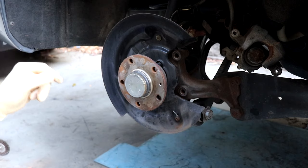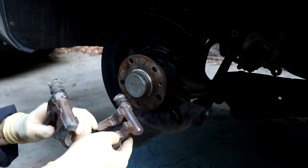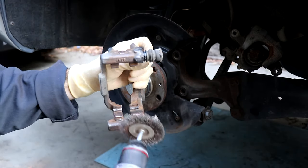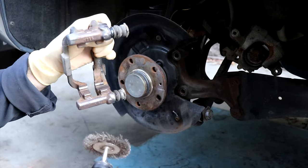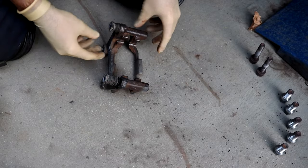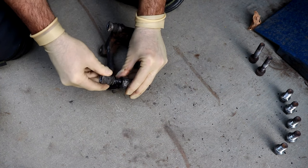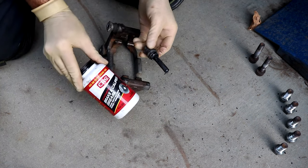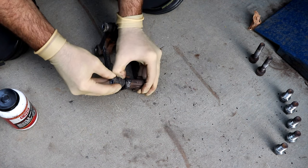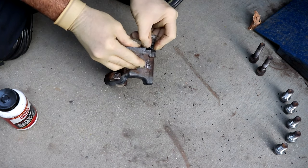Let's get them back installed. I just want to do a quick cleanup of the hub — you have the rotor attachment point and the wheel attachment point. I'm going to put a little wire wheel onto my drill and just give it a quick cleanup. What that'll do is help prevent stuff from getting stuck next time. I took the carrier over to the wire wheel as well — just give it a quick cleanup. Most important thing is to clean these grooves. You can also use the same kind of drill bit to clean up these grooves — you want to make sure you get any corrosion or buildup because that's where those little pad retainers go.